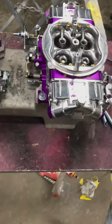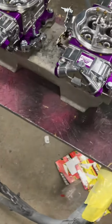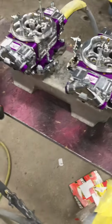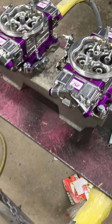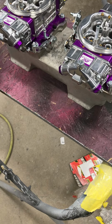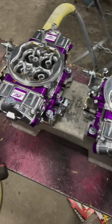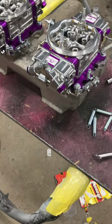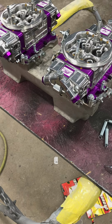It looks like it might be kind of hard to set up, but anyways, the whole setup on this engine, I never did really go over that with any of these videos yet. It's a 526 big block Mopar stroker, Trick-Flow 240 power port heads, Mopar Performance M1 tunnel ram, dual 750 Proform carburetors, my home built 2 1/8 inch primary headers, Harland Sharp rockers, and it's a Comp solid roller cam, so it should run pretty good.